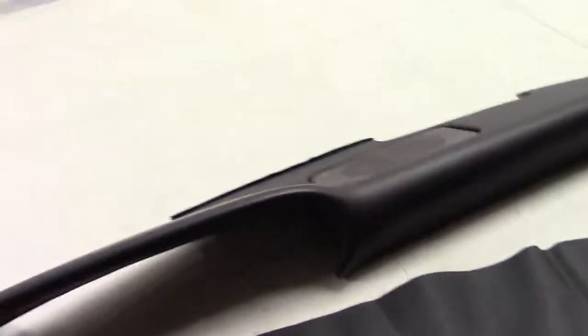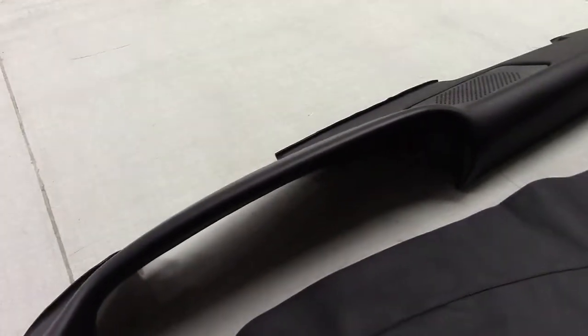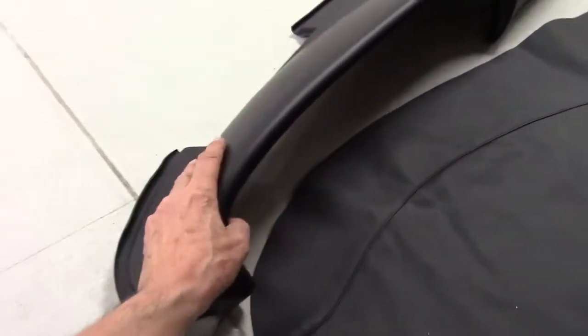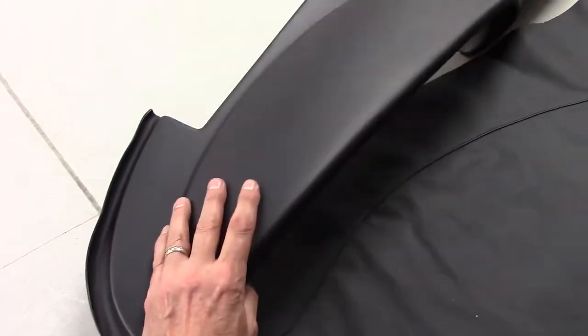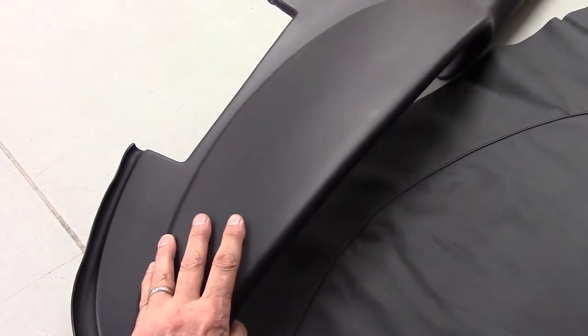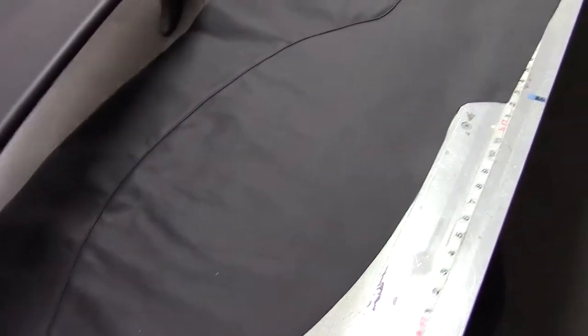We know that it isn't PVC because we had a big problem with our automotive solvent-based glue, which is crucial for the recovering of this dash pad in leather, reacting with this. What happens is the glue does not dry, and it has to dry on both surfaces, both the dash and the leather cover, to get the results that we see here.